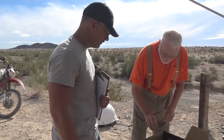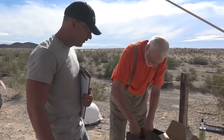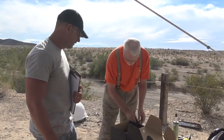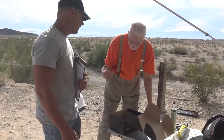I've got a fuse holder here — you gave me this. That's a 30 amp. Between the battery and the fuse block. This one is a 200 amp — 200 for the inverter. But the inverter's already got a fuse on it, so we don't need it for that.